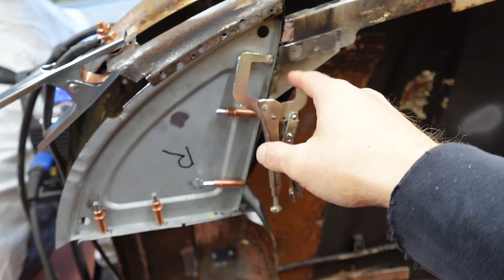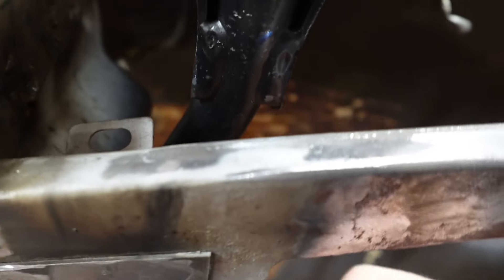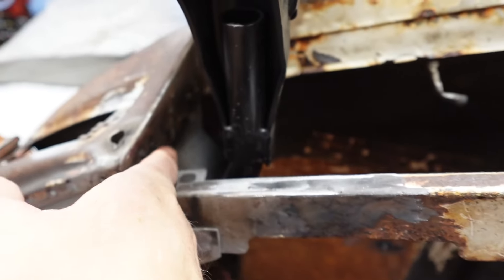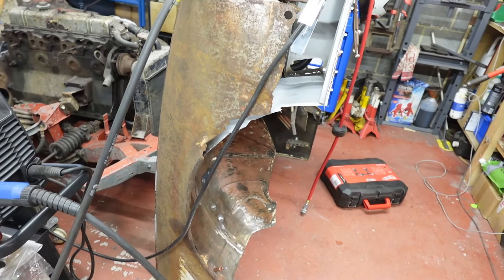I've got that little reinforcement piece in. Done a bit of manipulating and tidying up to fit this bit to one face. There's still a little bit of weld I want in there and in the corner there, which is going to be awkward to clean up. This obviously all still needs cleaning up, but I can't get anything in there till this hinge comes out — I don't want to do that yet. So the next step really has got to be putting the thing back on the chassis, getting it lined up, and starting to think about fitting up the wing. I'm going to call wherever we've got to done, because the next thing is to look at the wing, and the wing deserves its own feature being quite a large, important panel. So next time you see this it should be on the chassis, and we'll start looking at taking the wing off and getting the new one fitted up.